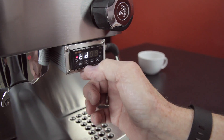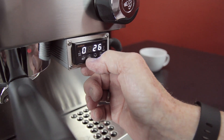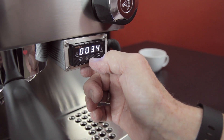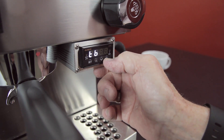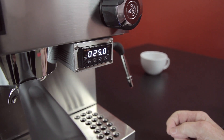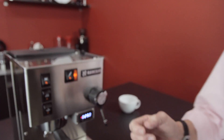This is the delay time — the wait time in between. We'll take it up to three seconds. And then this is the brew time. We've got that at 25 seconds, which is about right. You time your double shot 20 to 30 seconds — from the beginning of the pre-infusion to the end of the shot.